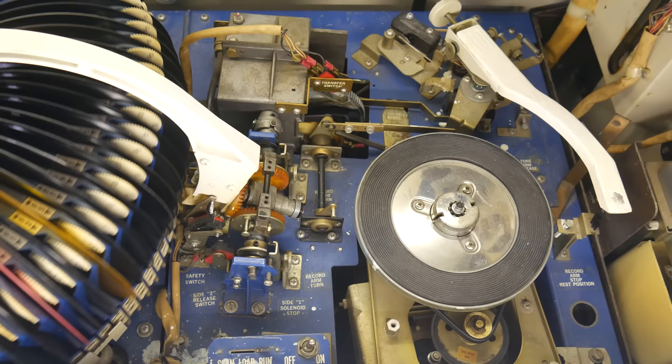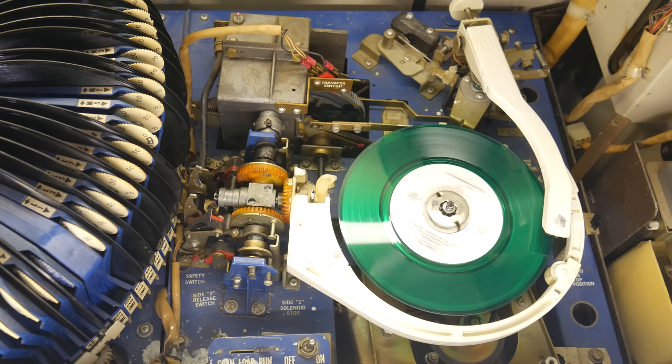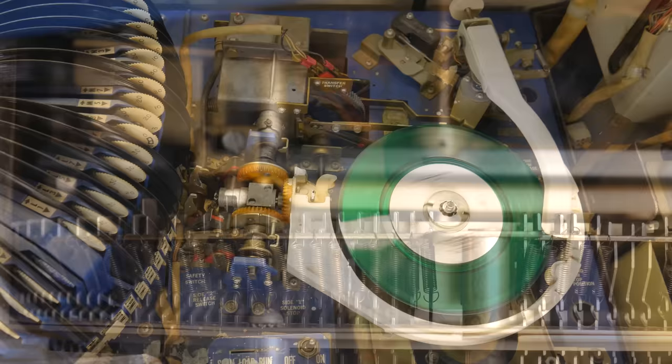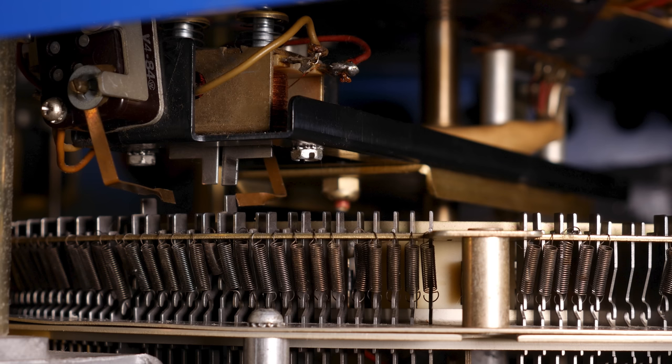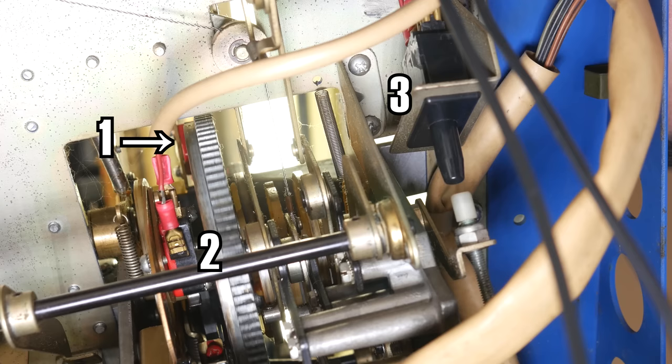See, in addition to all that mechanical stuff, we also need the Wurlamatic to stop in the middle of its sequence so that the record can actually play. And we also need to find a way to put the selection pin back. Because imagine, if the feeler arm is still touching that pin, well now, the jukebox is stuck in this state forever. So as part of the Wurlamatic mechanism, we have 3 control switches that are, again, absolutely essential to all this stuff happening. So perhaps the most important switch here is the transfer switch.